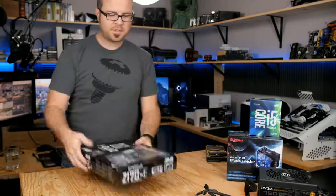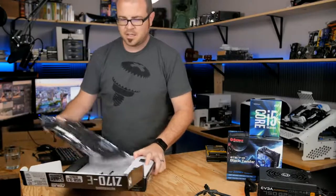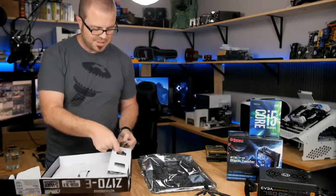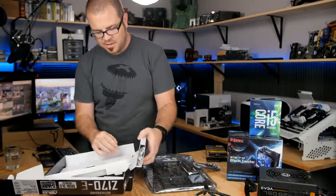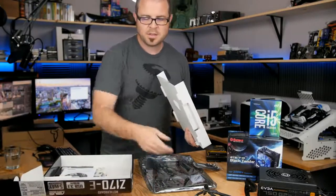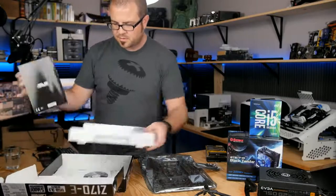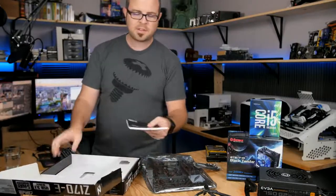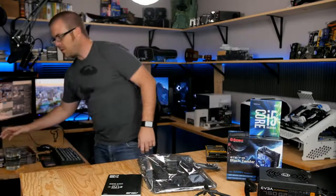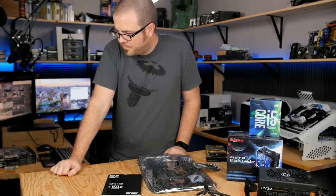The first thing I normally do when making a build is an outside-of-the-box build, but for the sake of expediency I'm not going to do that today. I'm trusting that the motherboard will work. But that is definitely something I recommend — get the motherboard set up outside the case with the processor and memory installed, hook up the power supply, power it on, and make sure you can get through the boot cycle before installing everything in the case. My original How to Build a Computer video guides you through that, but I'm going to skip it for today.